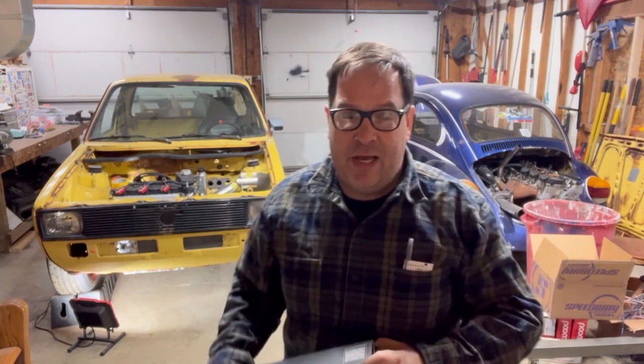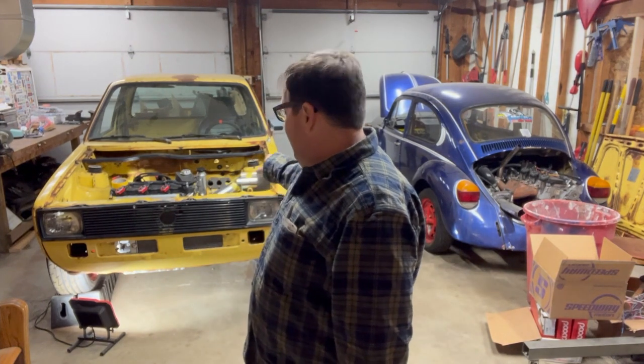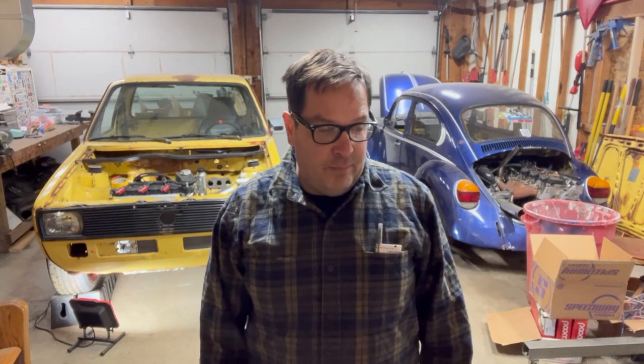Well guys, we got a little more done today. Got the radiator hoses checked off — that's completed, that's a nice one to get done. I thought the air box was going to be a little cleaner. This 90 that I got was the wider of the two, and it was cheaper so I thought I'd try it first — I should have known I was going to need the extra space. I'll just order the other 90. When that comes in, I think I have the box mocked up enough that I can go cut another piece of aluminum for the bottom, take all that stuff over to my aluminum welder, he'll put the bottom in there, weld that 90 in, and bead roll all of that radiator tube that I had to shorten. I think it's really good progress, but unfortunately I'm going to have to go back to the store and buy some more parts, and that's just going to take some time.